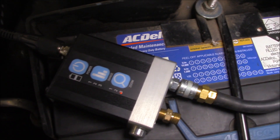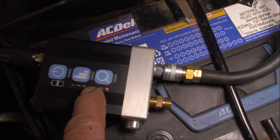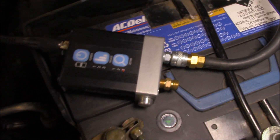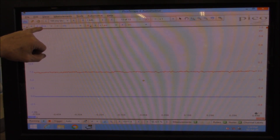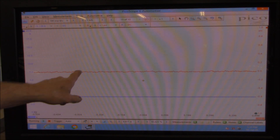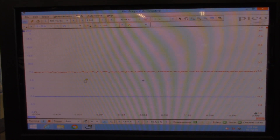At this particular point in time, I'm not sure if I'm doing it right — I just want to look for some strange thing that stands out. I've got it in zoom mode; I should have it in range three, which is about one to five PSI. But I've zoomed it right in because there's really not much pressure coming on the return line and I just want to see what it's actually doing. I've got my channel one current clamp set on 20 amps, and I have zeroed it as well. My pressure transducer is in the zoom range on range three, indicating one to five PSI, but I've also zoomed in as close as I can possibly do it, just to pick up any sort of information that's there. I've got a trigger set up and I've got it set at 100 milliseconds per division because I want to pick up as much information as possible. So let's start it and see what it does.